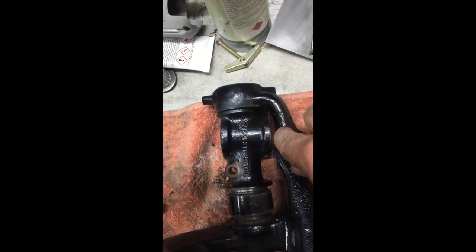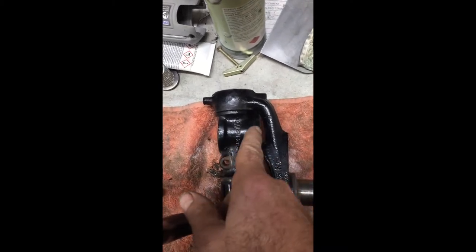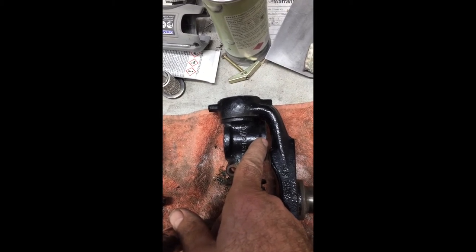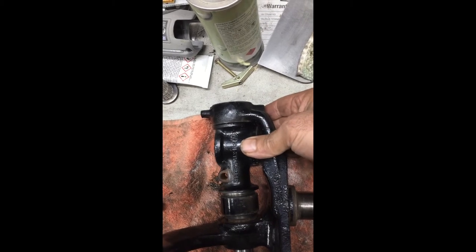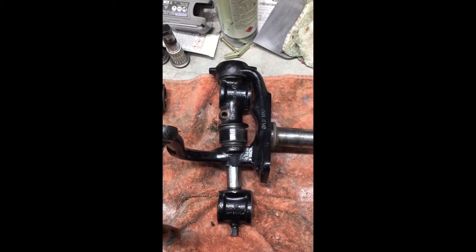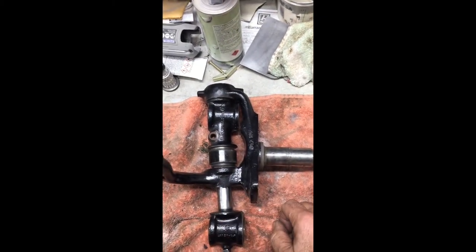We have to do a little bit of clearing with the grinder and a flat wheel on that. I'm pretty sure I might have taken a couple of mil off this guy here too. I need to go back and have a look at my other bus and check how I did that - it's been a while since I've done these. And then obviously this just gets pressed back together with all the dust covers and the shims in.